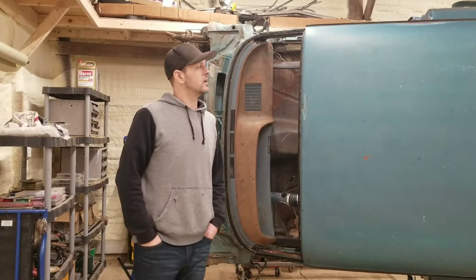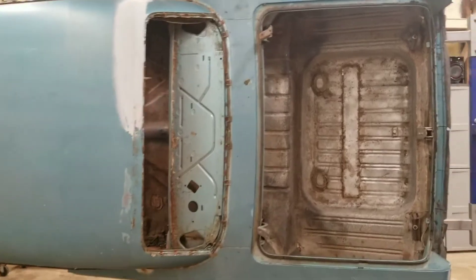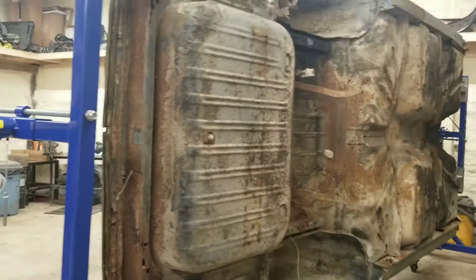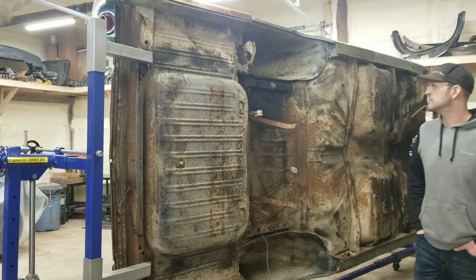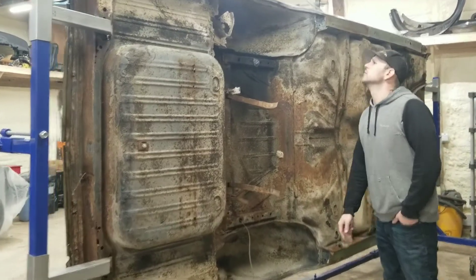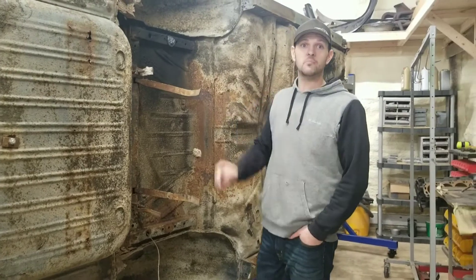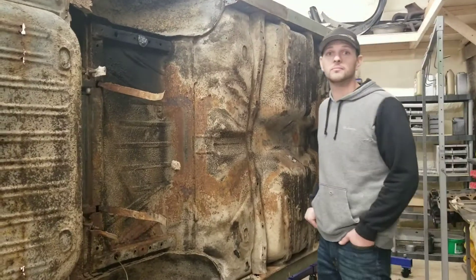We're going to call it a day. Just a quick update — we got the car jacked up, everything stripped off of it. We got it spun around so we can take a look at the underside. There's a lot of rot over here, guys — this is why we recommend taking them off the frame. A lot of stuff was missed that you just don't see. Once you get the gas tank out, you can really see a lot of rot in here. We're going to cut this stuff out the right way and do it all in new metal. If you want to see how that's done, make sure you subscribe and hit the notification bell so you get the videos as soon as I post them. Thanks guys.